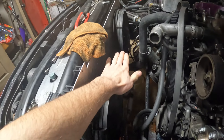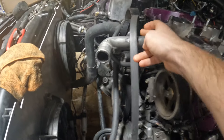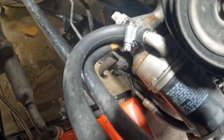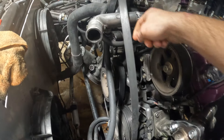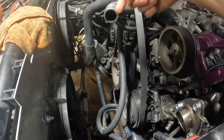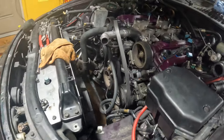This one's low and that one's higher. I want to place the turbo up here somewhere and this is kind of getting in the way, so I'm gonna need to probably cut this — either just put a stock one back on and weld this bung over here that goes to the OEM 2UZ oil cooler and move it up here sticking out the side, or just keep it right there and shorten it down a little bit to keep everything away from the turbo.